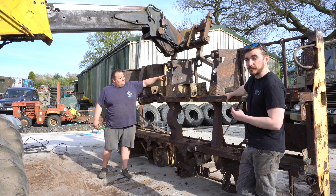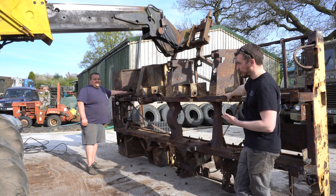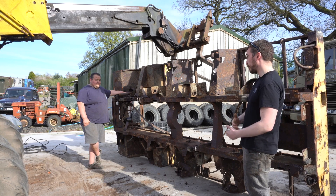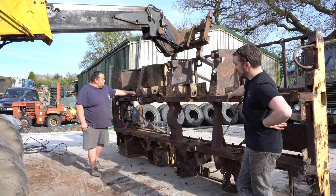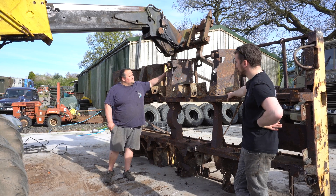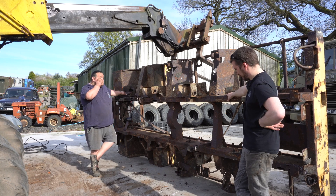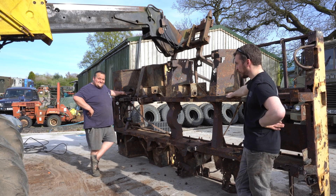The reason we're not going straight to shot blasting is because once we've knocked off all the loose stuff, we actually want to 3D scan the entire chassis. It's probably not the way most people would do this, but we want to get a virtual model of what this chassis is supposed to be like before it goes to the proper shot blast process, which is obviously going to take away a lot of what's left of the metal. We foresee losing details like this - it would be difficult to recreate bits if we've lost the original geometry. If we can capture a 3D model before it's totally blown away, at least we've got something to work with as a reference piece. Right, let's get it hitched up.